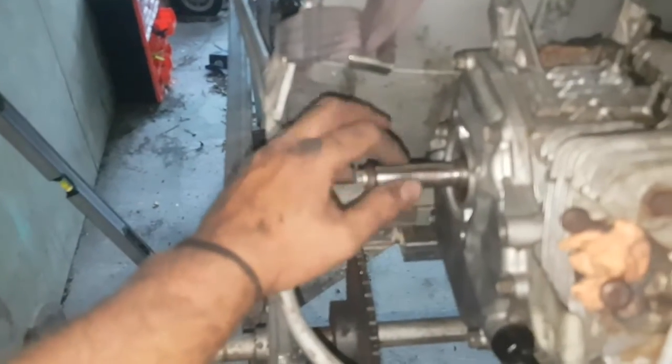I might put some braces back in, maybe some straight bars back to where they were. I'll be careful not to get in the way of the clutch. But yeah, she's looking good. Just got to set up a linkage here. There's the accelerator, it'll pull that. Rev. But as that pulls, I'm going to set up a linkage from here to here, and that'll control the throttle.